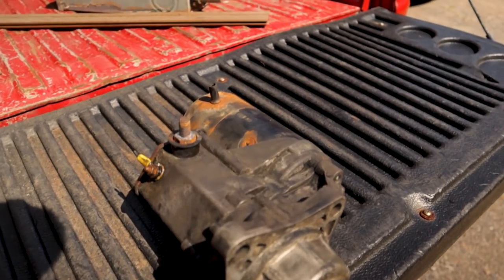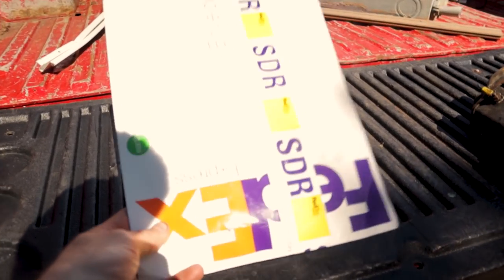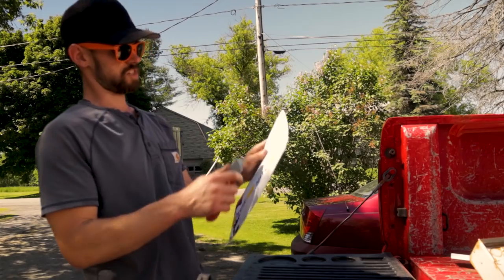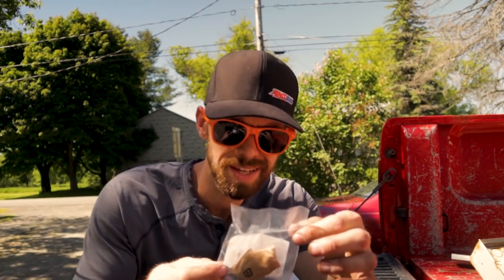We do have our other package that we were expecting in the mail today — this is from our boys over at Diesel Auto Power. Thank you to you guys for getting this sent to me in a timely fashion. All right, here's what we got. We got one little baggie and it happens to say Bosch on it. We have an overflow banjo bolt — an overflow valve for the VP44, which is basically a banjo bolt with a little valve in it, a little orifice so it can bleed out air. This little guy installs into the VP44 at your fuel return line. And they were kind enough to throw in a couple of sealing washers too, because you have to buy them in a ten-pack and I only needed two. So they just gave them to me — thanks guys.